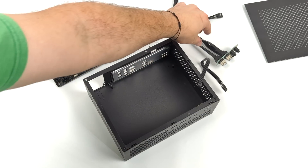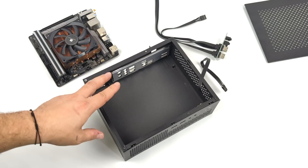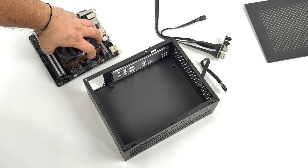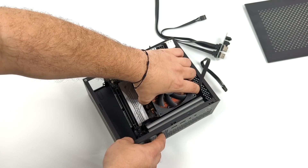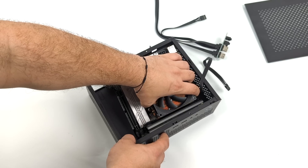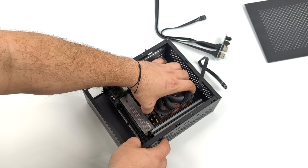This AO9 case is definitely going to be tight with a dedicated GPU, and I did have to remove the front USB panel. It just comes right out with two screws, and it makes it a lot easier to get your fully assembled motherboard in here. With it installed you can still get it in, but it's going to be a tight fit — you have to wiggle it around a bit, so I just opted to take it out.